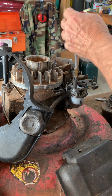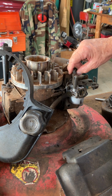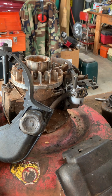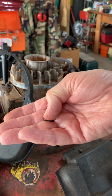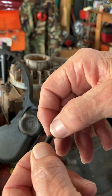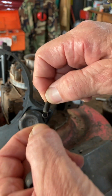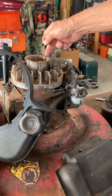This is a 1/4-inch socket, and I've tightened it some, haven't over-tightened it, and see, this is free movement, okay, but once you put that spring on there, which is this little guy, this is what was missing. He had a spring that was too strong, looked like he'd pulled it off a ballpoint pen or something. This tiny little spring with the circles on the ends is correct. And it's very weak, and it needs to be weak because this arm pushes it out of the way when this thermostat gets warm.